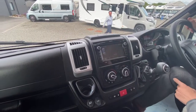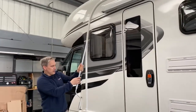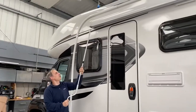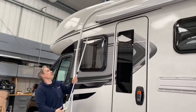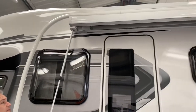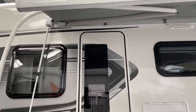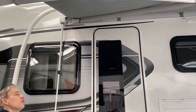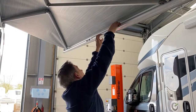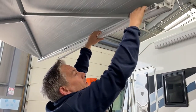To use the awning, grab your awning winding handle. The pole can extend or shorten — extend it a little, then pop it into the awning bracket which just slots in. Wind it out so that you can reach the awning. Once it comes out far enough to reach, twist the handle. Grab the awning leg, pull it out and down from the side, and put the leg flat.